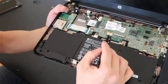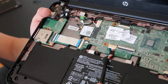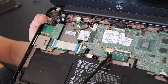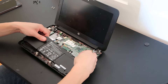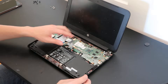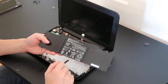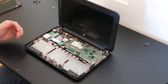The battery is held on not by a ribbon cable connection but by a plug. When you go to unplug it, don't grab the wires and pull — you'll often break it. Put a fingernail on either side and wiggle it out, making sure you pull from the connector, not the wires. The battery comes right out. This battery is an HP PE03 model — you can usually get the part number from the sticker on the battery itself.